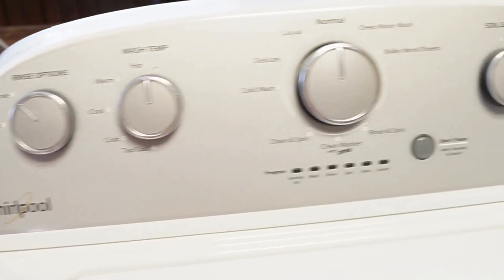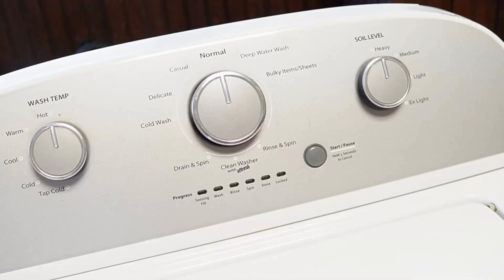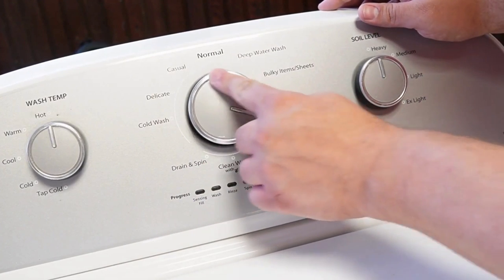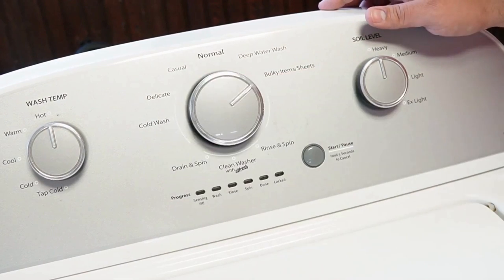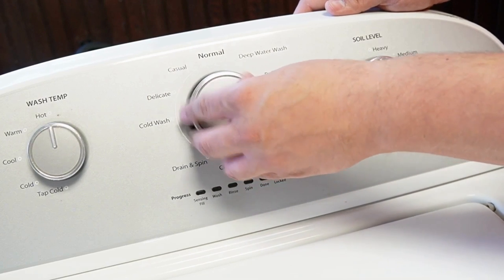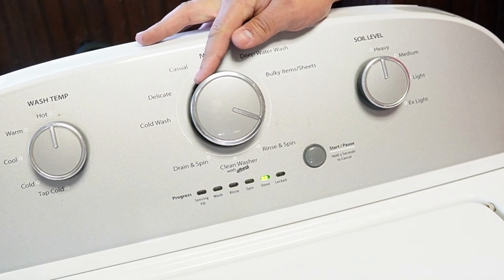This is the first type of reset, which should restore your washing machine to all default modes and settings. Now let's attempt to recalibrate this washing machine through the calibration mode. This is a must-do if you've installed any new parts on the washing machine, from a board to a balancing rod. With the washing machine freshly rebooted, rotate the dial counterclockwise 360 degrees, then turn the knob right three clicks, left once, then right once again. You need to do all these things within three seconds, and it may take a few attempts — but if you've done this right, all the lights at the bottom of the washing machine control should flash on and off, showing that you've entered into the diagnostic mode.